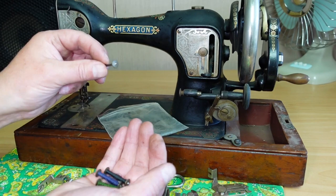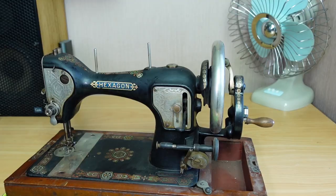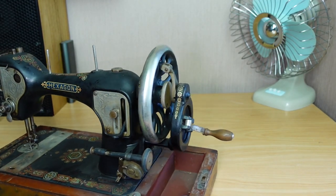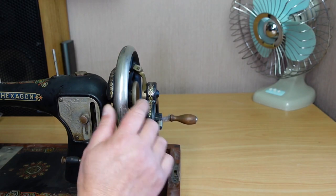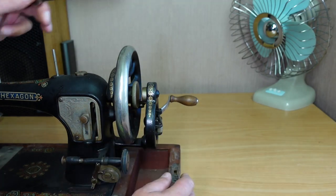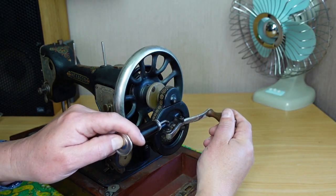But let's have a go at winding a bobbin and thread her up and see if she sews. Before we do that though, let's start by oiling the machine. We'll start over here on the hand crank side — generally there's a hole for oiling in here, just a drop of oil there, and there'll also be another one just here on the hand cranker.